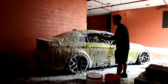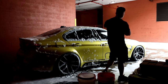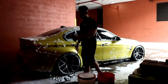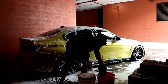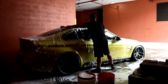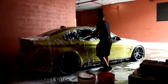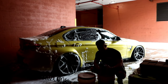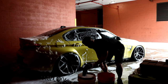Switching from level D to level E on the foam gun — you can see it's more of a thicker foam now, meaning it's more concentrated. The car is completely covered with suds. This is the two-bucket method: I've got my clean water bucket, I dip into my soap bucket, get all the soap, and start from top to bottom. The reason you start top to bottom is because a lot of your dirt and road grime is towards the bottom — you don't want to take the dirtiest part to the top. Rinse the mitt into the rinse bucket multiple times and dip back into the soap bucket.